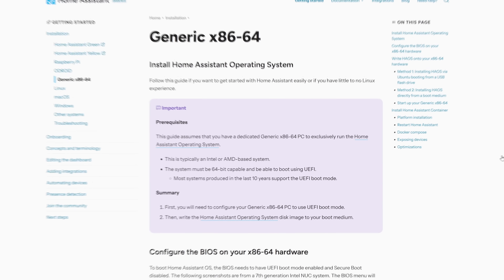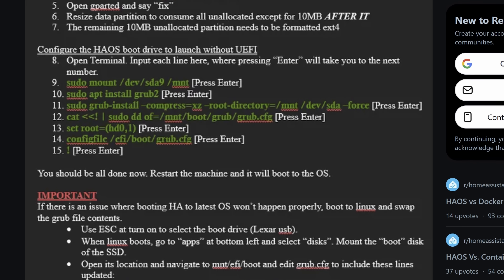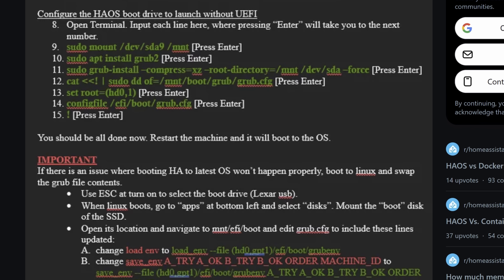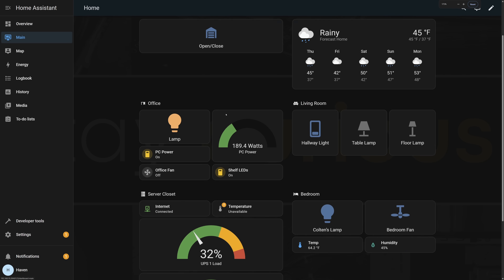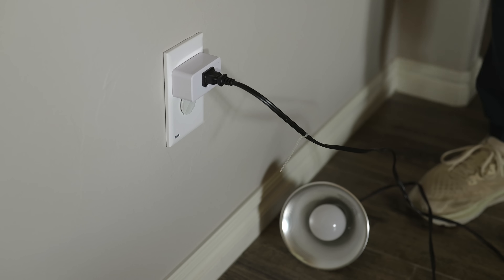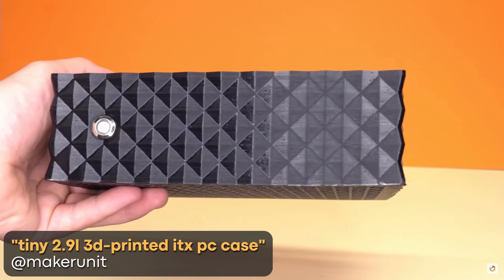Which gets me to what I really wanted to do with this thing — running Home Assistant OS. As I mentioned, Home Assistant OS requires UEFI support, which this system doesn't have, but I actually ended up finding a fairly easy method to get it working thanks to a Reddit post. Long story short, using a live Linux USB drive, you just flash the Home Assistant OS image onto your SSD, but then you also add another partition and manually install and configure Grub2 so that your system actually boots up properly. After doing that, Home Assistant fired up just fine and worked as expected. Honestly, with this drawing so little power and being completely silent, this could work really well as a dedicated little Home Assistant box — especially if you added on a Zigbee radio or something. In fact, I plugged in a little Sonoff dongle and just added a Zigbee smart plug in a few seconds. I think with how I use Home Assistant, this thing would be plenty, although I'd probably try to 3D print a little tiny case for it or something that doesn't take up as much space.